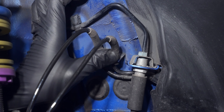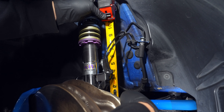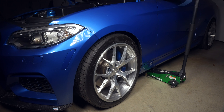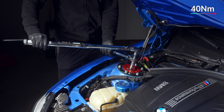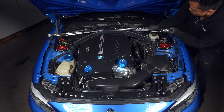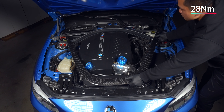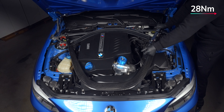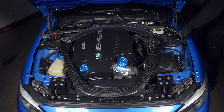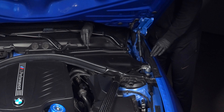Just know that there is a trade-off in comfort when going to stiffer linear springs, so I'll also leave some additional resources and links to everything we used in the description. This should be a very safe height for your wheels, tires, and fenders, but expect to adjust it again after this. Let's bring it down and re-torque the top nuts now that we have the weight of the car on it. Bring in the aluminum brace — only the two top E18s get 56 newton meters, while the E12s and T50s get 28, which happens to be the same for all the 13mm bolts on the carbon brace. Start from the front and work your way to the back, then put back on all of the coverings, push rivets, and the covering held in by the T20 screw.